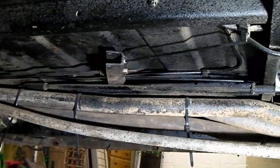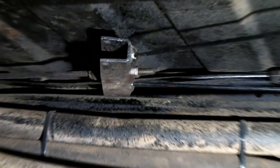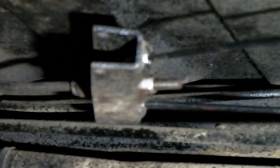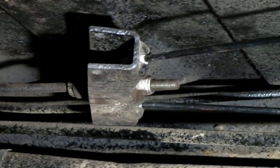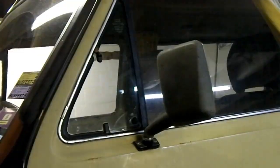But I did have the floppy mirror syndrome driving back and the old mirror flopped in, so we're gonna see if we can tighten them up. There's that little adjusting screw right under the middle of the bus - all I did was backed that one off a couple of turns and that was it, it's fine.